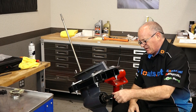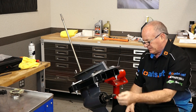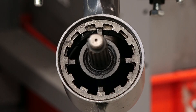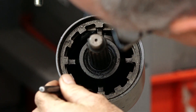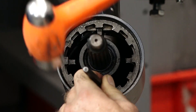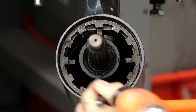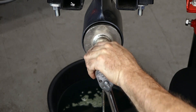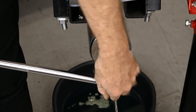While that's draining, we can go ahead and start to remove the output shaft carrier. Get all of these bolts out. Now let's reach in — there is a washer with a couple of different tabs, and it looks like there's just one that I need to bend back right at the bottom. Now we're going to be using a Yamaha retaining ring removal tool. Let's put a little bit more authority on it.